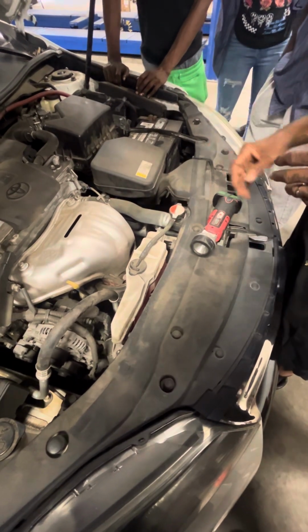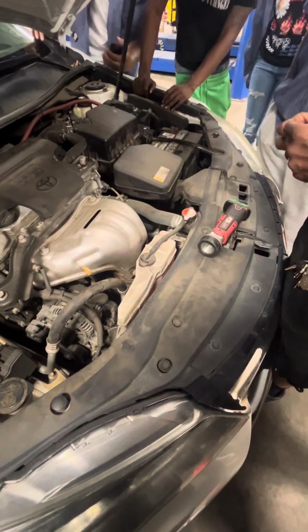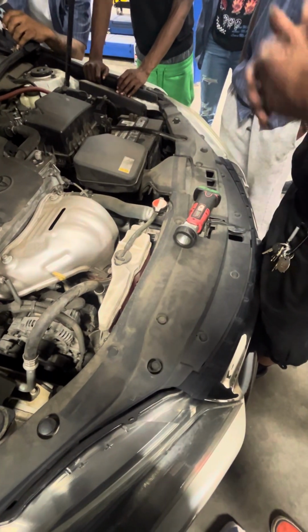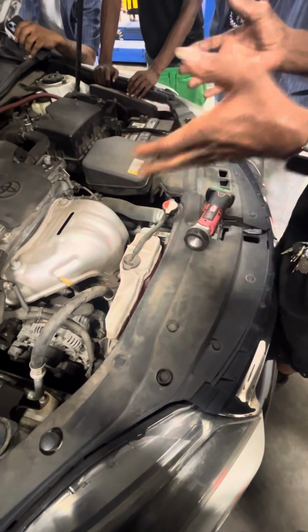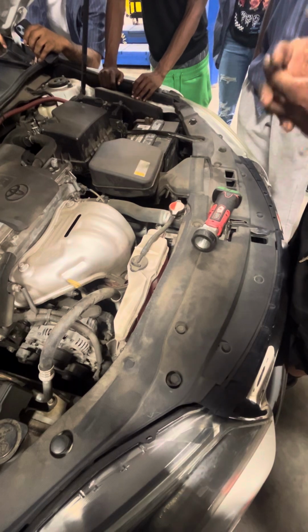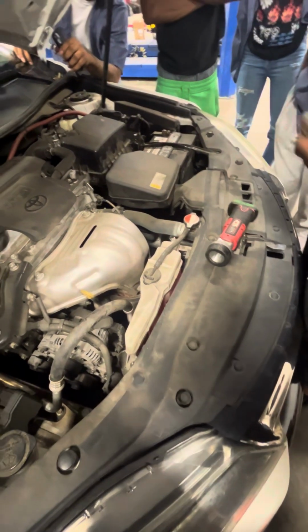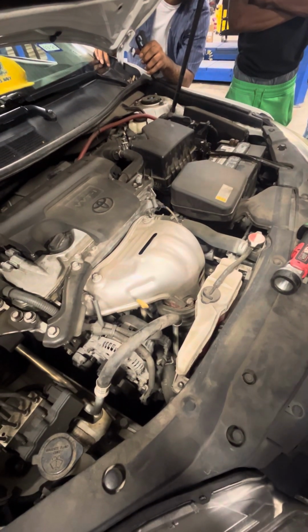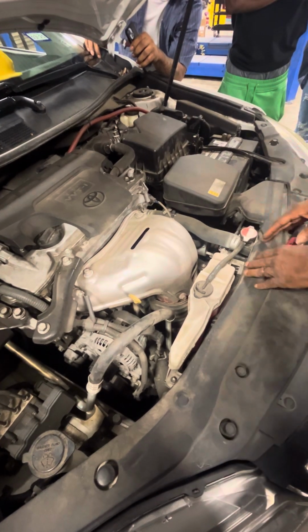If your customer complains that the vehicle is not putting out any heat, what would be your first visual inspection check? The heater core. How are you going to check the heater core? The heater core is inside behind the dash. You're going to check for leaks, aren't you? Kind of, sort of. You're kind of close to what you'll be checking. You'll be checking the coolant.